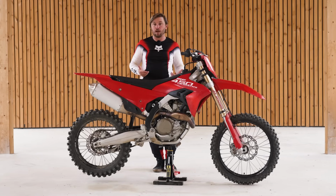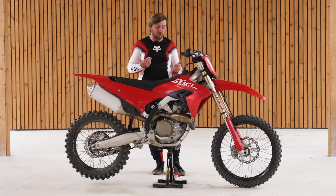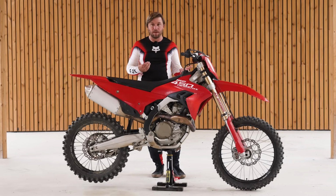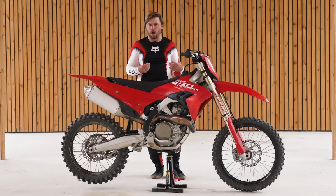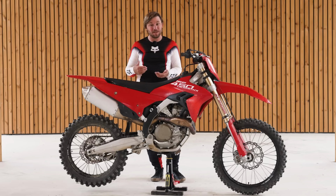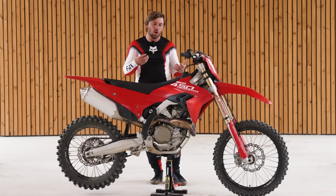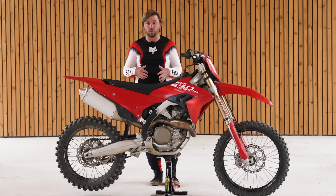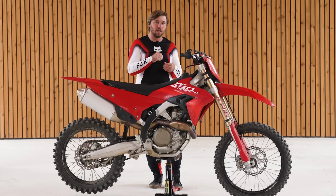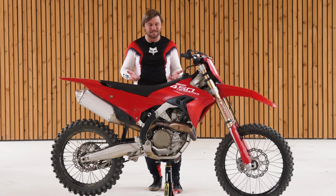The Fox Instincts I wear are a little bit wider, and the team actually mentioned to me when I commented to them, hey, I'm having moments where when the quick shifter is on, I'm feeling hesitation or the bike trying to cut the quick shifter, but not when I'm fully shifting. And the first thing they identified was the boots I was wearing. They basically told me that Jeremy Seewer, who is also in Fox here, has run into the same problem. So if you have a wide boot or you have your toes really far in and you bump the shifter arm where it comes out, you can accidentally engage the quick shifter function a little bit. And I caught myself doing that a few times, so I went ahead and disabled the system.